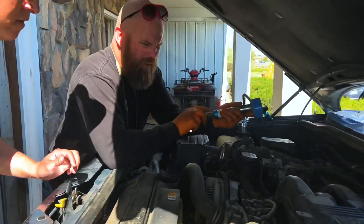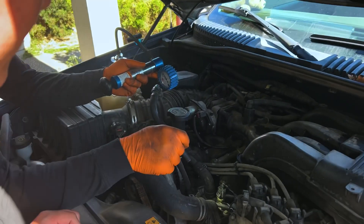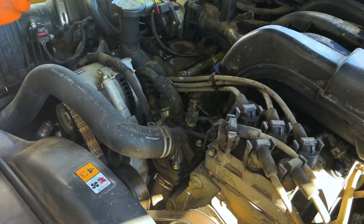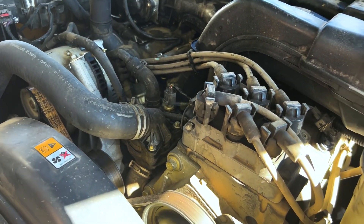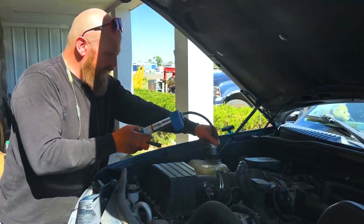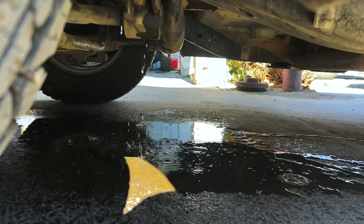It's leaking out back here — okay, it's cracked, just like my buddy said it's probably cracked. So that's going to be this whole housing here. Let's do a block test anyway, because we don't want to — if you've got it too hot and it's warped or something, you want to know now.